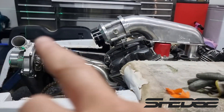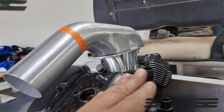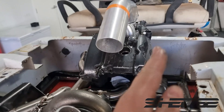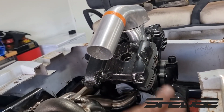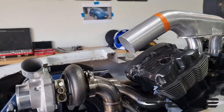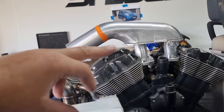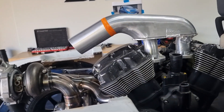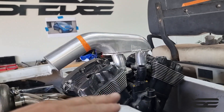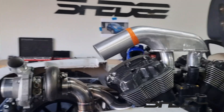In theory this should be a 45-degree angle to meet up to them roughly. Here go our runners roughed out - as you can see we've got a 90-degree here cut in half, basically pushed out as far to the rear as we can, and it's roughly a 45-degree angle. It's now running parallel with the motor, which was the main thing. We'll never get it sitting bang on center - that's just physically not possible without having long runners out either side. Pretty happy with how that's sitting, it looks a lot better than it was. We'll put that tube on the front just to take off a lot of weight since the throttle body setup is quite heavy. We'll start finishing up those tubes, drop down a lot lower to where the drive-by-wire is going to end, and get our angles sorted.